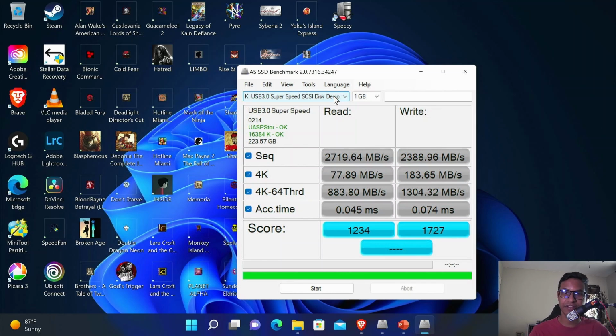Okay, right now I'm going to test a 2.5 SSD made by Crucial. Let's see how much I get here. So I got a score of 670 for my 2.5-inch SSD. That's not bad, considering I'm testing this 2.5 SSD through a USB 3.0 hard drive enclosure, it would have scored better if it was directly plugged into the SATA port. Okay, so it is safe to say that this is a decent 2.5 SSD drive.